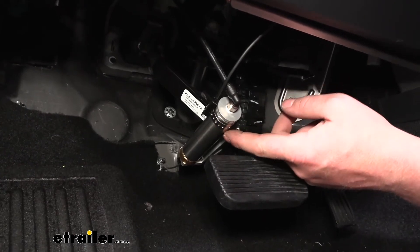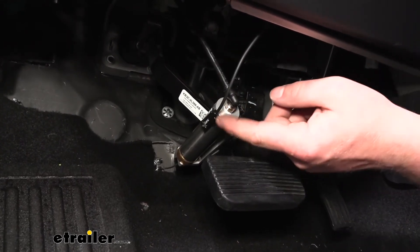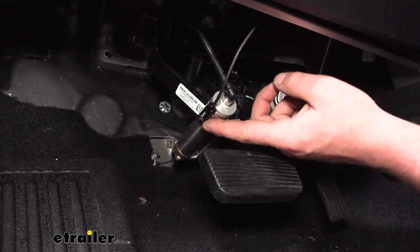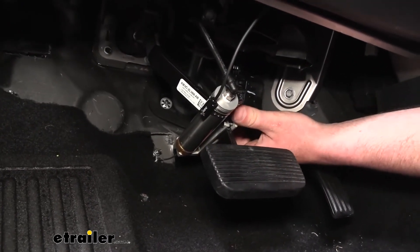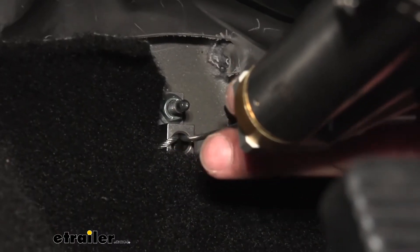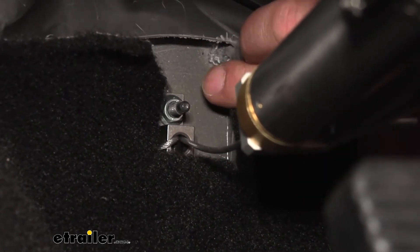Underneath the dash on the driver's side, this is where our airline tubing and brown wire came through. The airline tube routes to an actuator cylinder we're going to bolt to our brake pedal arm. The brown wire runs to the same place — there's a switch on the actuator cylinder that the brown wire connects to. Here's what the actuator cylinder looks like. First, take the reed switch and slide it into the small housing, then use a small flat head screwdriver to barely snug down the bolt — just enough to keep the switch from moving. Then take the actuator cylinder and use its clamp to bolt it around the brake pedal arm.